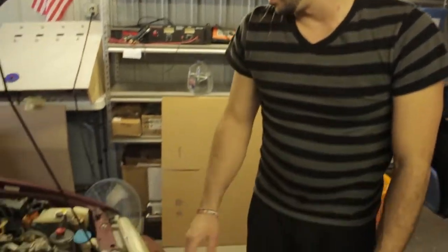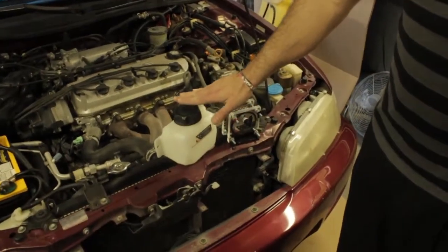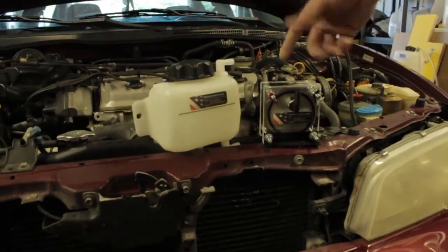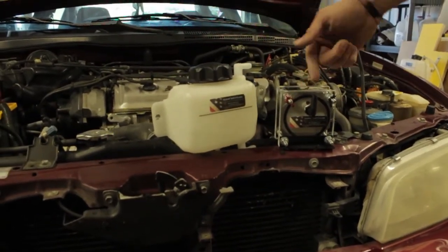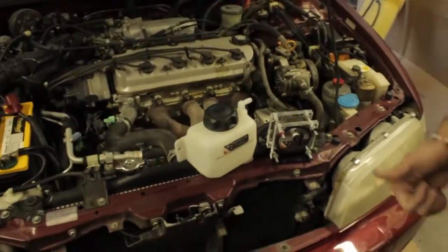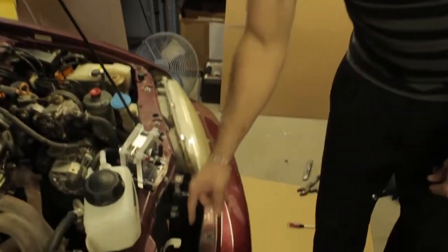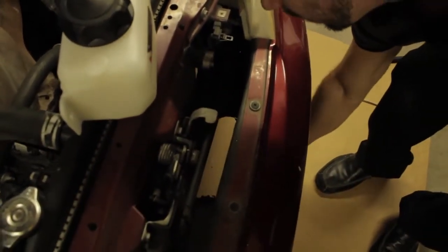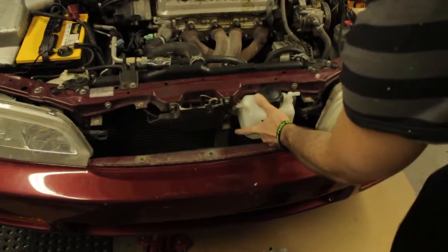Back on our install, the 1996 Honda Accord 2.2 VTEC. The main components of your system are going to be your water reservoir, which holds your electrolyte and distilled water mixture, and your nine-plate HHO dry cell. You can call it a generator or a cell, but this is the main component into which the water flows and comes out converted from a liquid into a gas — that's the HHO we're using. We've made a space to hang the cell either within here or just below it, and we've made an area to mount our tank.